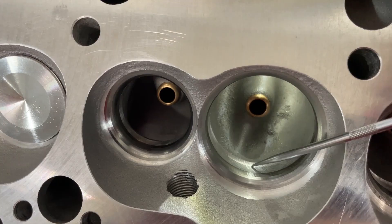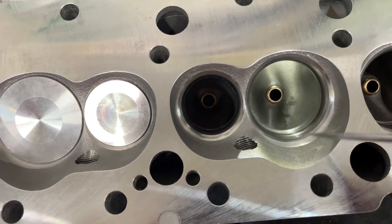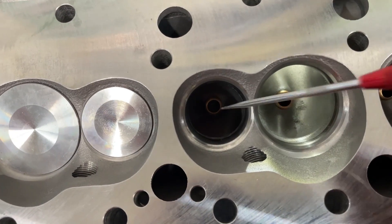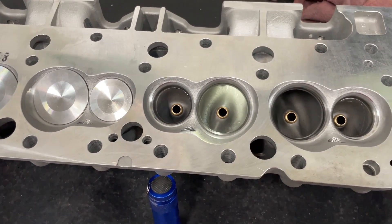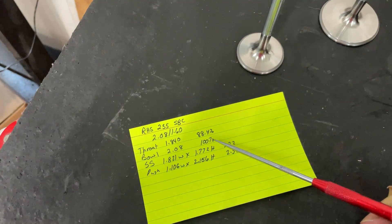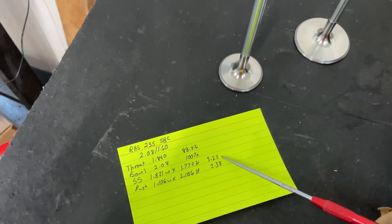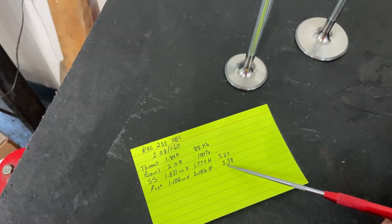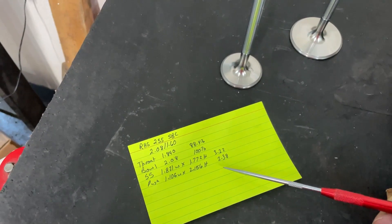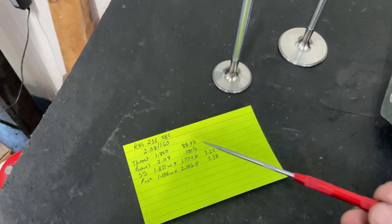Unlike the other heads being reviewed, this is the only one that's not bowl blended. That's why you've got that ridge there on the intake and a ridge there on the exhaust — the exhaust ridge is really going to hurt flow, I can tell you that for sure. This head typically, because I used to port a ton of these, can be made to flow big amounts of air. It's probably going to run around 300 CFM as-cast. The bowl is 100% which is appropriate for the size. The throat is 88.4%. The area over the short side is 3.22 — I've told you before, if you drop the decimal that's usually about what it flows, so theoretically about 322 CFM if everything else was right. The pinch is small at 2.38 from a 235 CC head — that's too small; it needs to be like 2.5 or above. They were probably just trying to get things to work within the casting.